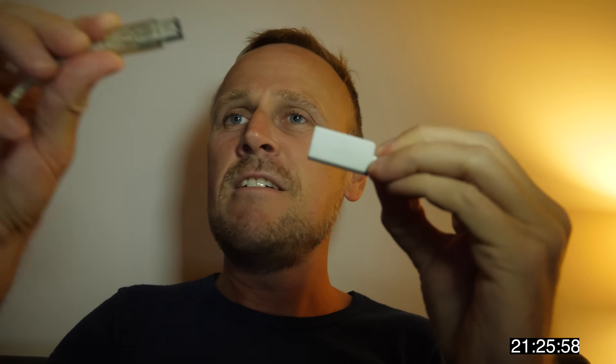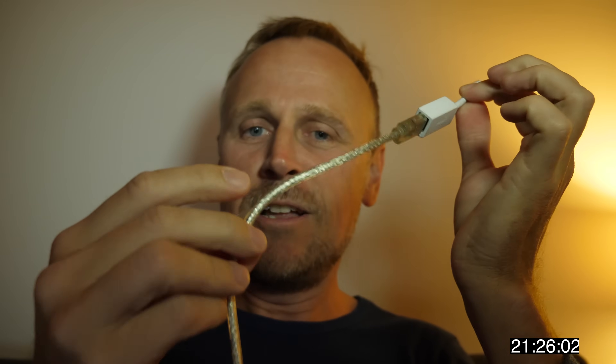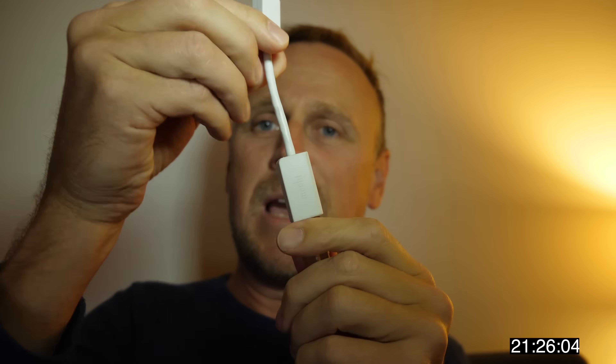Since the 1990s, Firewire 400 has changed to Firewire 800, and that looked like this — that's 800, and that's what the new Macs were taking. So what you have to do is convert this end into Firewire 800, and I've done that with this little connecting cable. This guy goes in here — 400 into 800. This doesn't change the throughput; it's still 400 megabits a second even though this cable is rated at 800. Doesn't change anything.